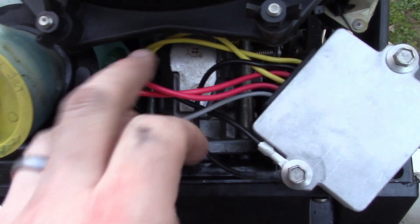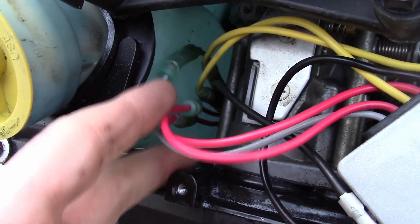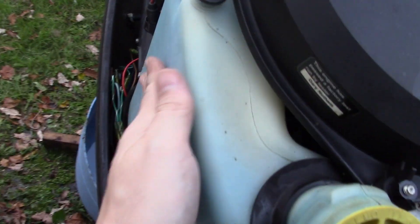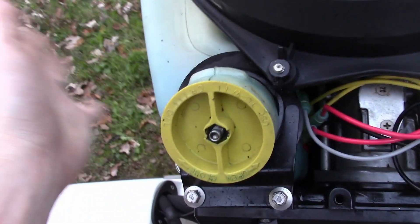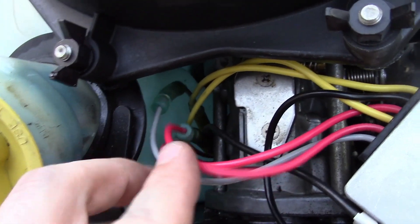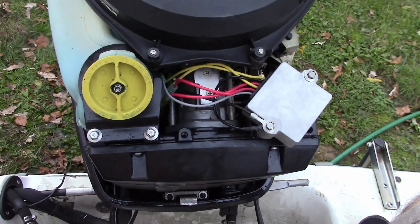Full disclosure: I read a little bit more about these wires, and apparently these bullet connectors are notorious for having bad connections and shorting out your voltage regulator. It's now winter so I'm not going to worry about this right now, but in the spring I'm going to take off my oil tank, check my oil injection lines, and use some watertight marine splice connectors in there. I hope this video helped you — thanks for watching.